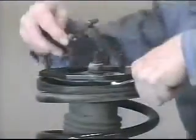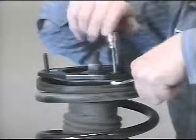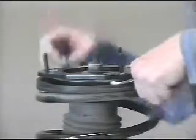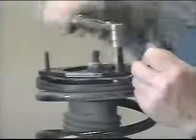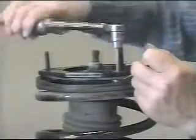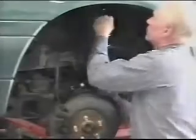While exerting pressure on end of wrench, install short Allen bolt through camber plate in position needed for desired camber change. Hand tighten only. Torque bolts 26 to 30 foot-pounds, 35 to 40 Newton-meters. Reinstall strut into fender tower using nuts and washers provided. Torque nuts to 26 foot-pounds, 35 Newton-meters.